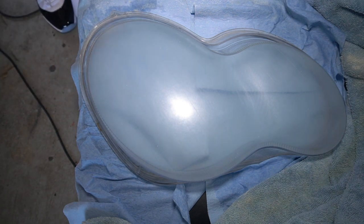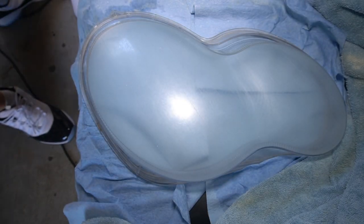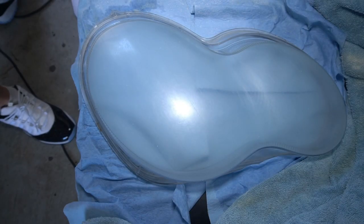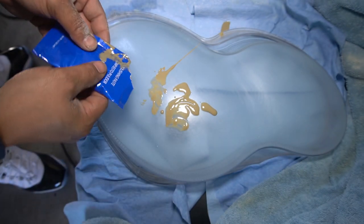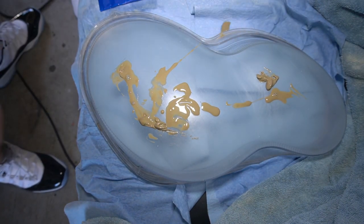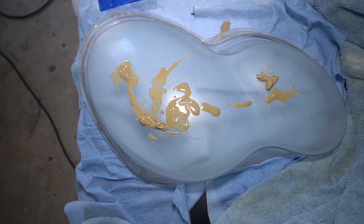Now, for this step, we're just going to rip open the polish that they give you and apply it on the lens and begin to polish the lens. Now, you basically do this until you are happy with the end result. Now, as you can see, it's a bit liquidy at the moment. You're meant to mix up the bag really well. As you can see right here, it is a thick type of creamy paste. It is just a little bit liquidy at the start. It doesn't really matter. The end result is going to be the same, because after all the liquid is dried out, you will get that thick paste, and that's the actual polish itself,